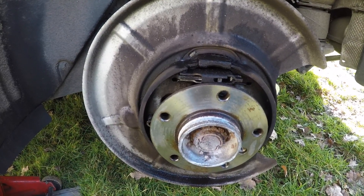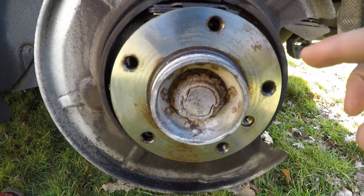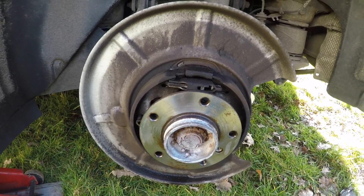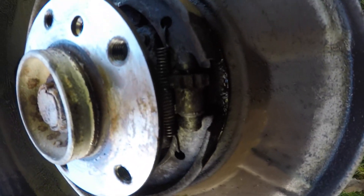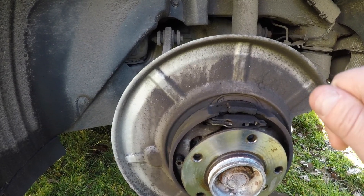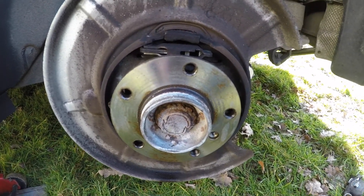As you can see, the other brake disc is off on the rear. I'm going to show you down here the adjuster for the handbrake to adjust the shoes — it's right there. What you have to do is turn the hub and get this screw in line with that adjuster. Now you do not have to take the brake disc off to get to the adjuster — just shine a torch in and the adjuster sits right down here. You turn it up to tighten and down to loosen — or actually up to loosen — to adjust the handbrake shoes.